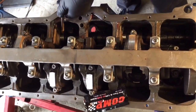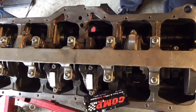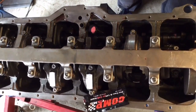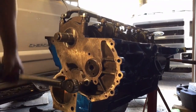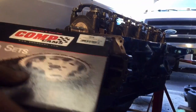Just give the bearings one more shot of oil before we slide them in the rest of the way. Before we put the cam sprocket on, tighten the wash-out plug to 30 foot-pounds with some thread sealant. Now it's time for the timing chain.